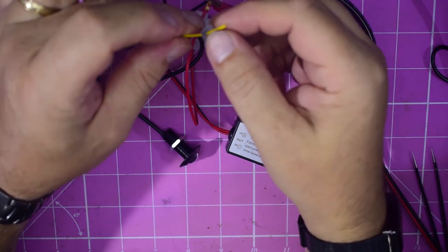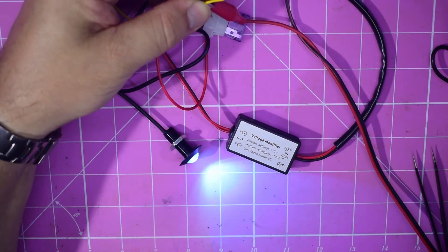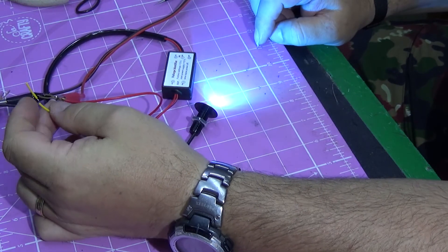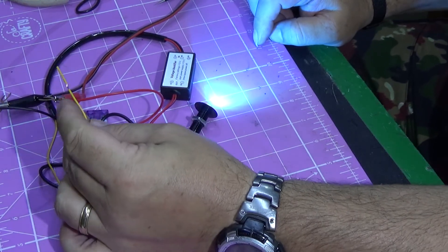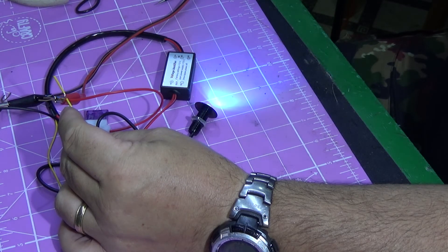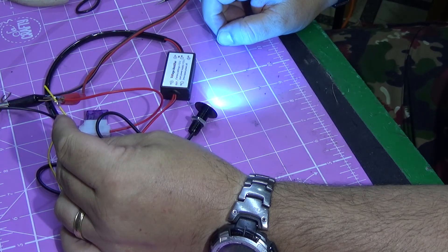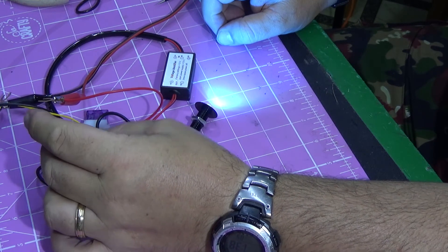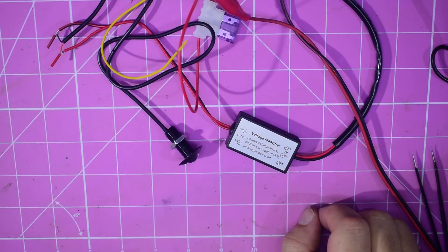Let's start the car again. We'll connect the switch to the battery like this, and we'll start the car and take it to its normal running point. And it's only a momentary switch — it's not a constant switch. That's what I was doing wrong. It's only a momentary switch while it measures the voltage. And then when your voltage drops again — in this case I'll drop it down to 11.5 volts — it should, after a period of time, switch off the lights, which is what it does.